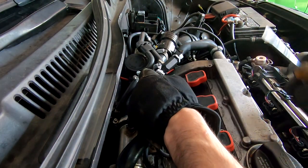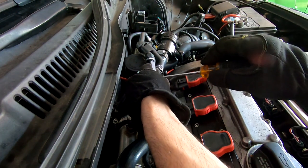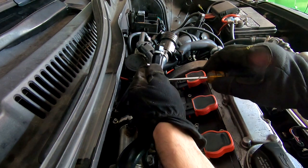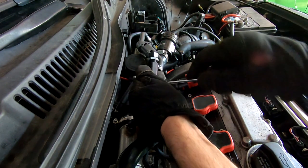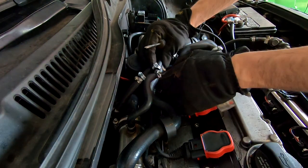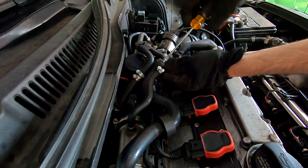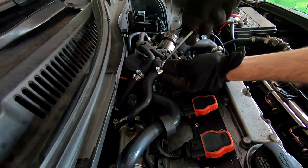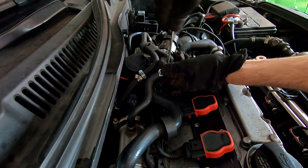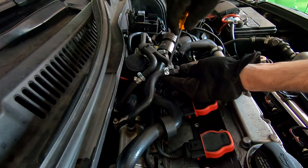Let's try this now. I'm a little concerned that this manual boost controller might have the wrong diameter pipe fittings — I bought it for a Jetta, but these look pretty tiny. The inner diameter on those nipples seems smaller than an eighth of an inch, which could be my problem. But again, this is just a test run. I'm going to leave it right the way it is and go back out for a drive, hopefully getting a reaction out of the car.